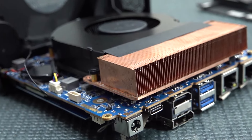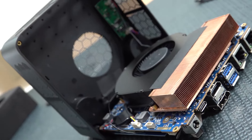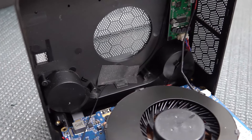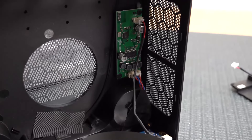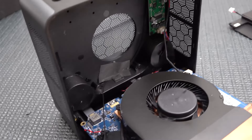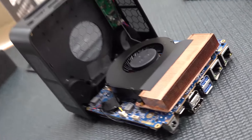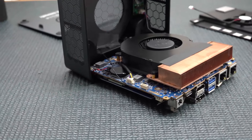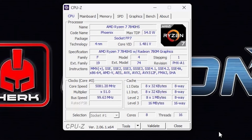Opening this up is quite easy, but you need to be careful with the Wi-Fi antenna cables. One interesting thing is that this does come with built-in speakers — you can actually see them inside. There's an amplifier connected to the main board driving those speakers, which is an interesting construction. If you want to replace the battery, it's located under the main board, so you'd need to lift it out to do that.